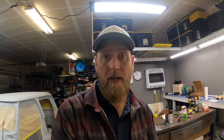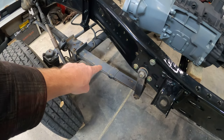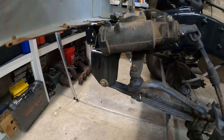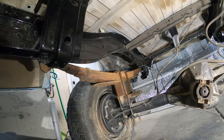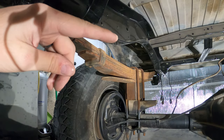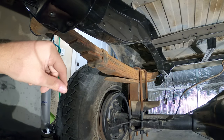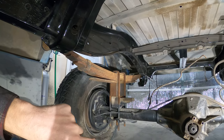Now I need your help on Long Bed Larry. Next video we're going to be trying to figure out the rear spring setup. Up front we have these springs — I think they are stock but they're an aftermarket version — and then we've got these Jungle Gym extended shackles and a Jungle Gym drop hanger up front. In the rear we've got a four-inch block and looks like a two-and-a-half inch block. I think these are stock Dodge rear springs, but even with this setup the rear sits a couple inches lower than the front. So what I'm trying to decide: do I go with like some Skyjacker six-inch or eight-inch lift springs, or do I remount the shackle hangers and do some 64-inch Chevy springs? Let me know what you guys think — I need your help. I'm not a suspension expert.